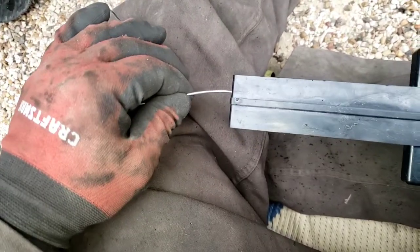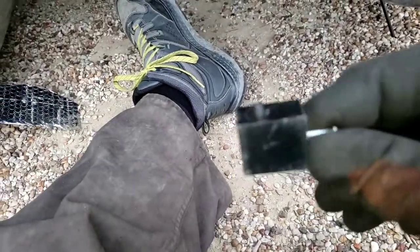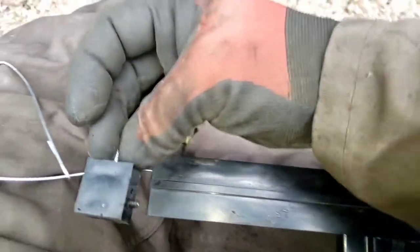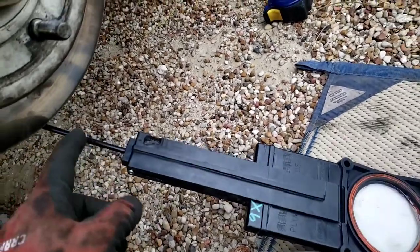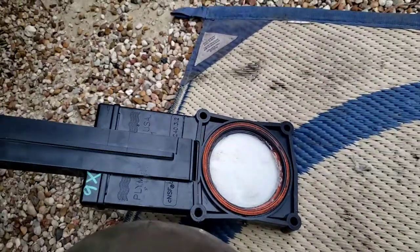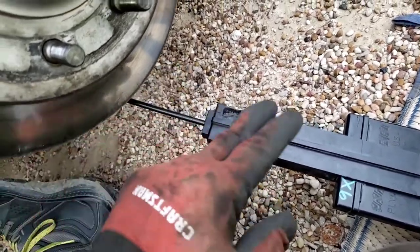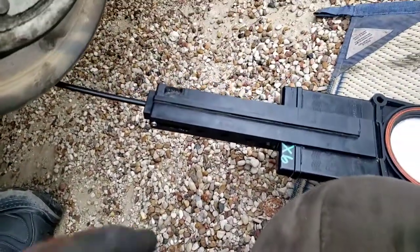I'll remove my little handle made from the old wire, set that up, and go into the set screw adjustment. This is what's used to make adjustments to how far the gate valve opens and shuts — there's a little set screw on the inside. If your gate valve when fully shut doesn't completely shut, you usually just have to peel back a little bit of the housing to allow more cable to be exposed, because this inside bumps up against this. You set that set nut in there, flush it, it locks, and then you can put your handle in and your screw in.